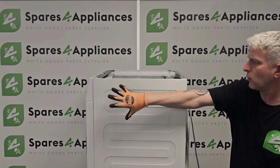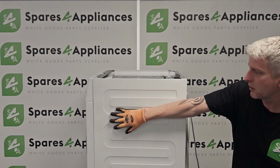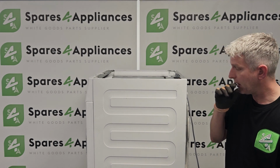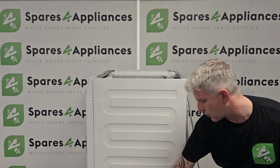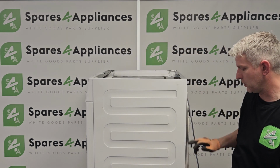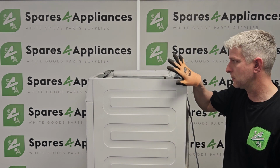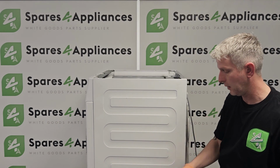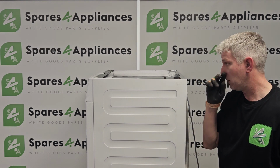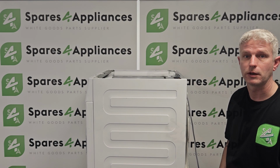When you get those screws out, this panel should slide backwards ever so slightly and then lift away from the machine. Very occasionally there can be a screw underneath, so if you've taken these out and the obvious ones down the back, and the panel is still not moving, then tip the dryer up a little bit and have a look underneath to see if there's a hidden screw. But once you've got all these screws out, the panel will come off and then we can show you the capacitor.